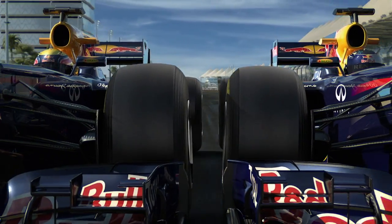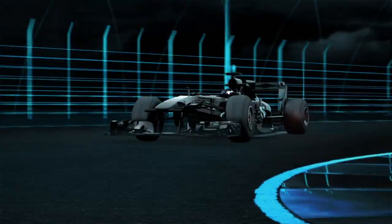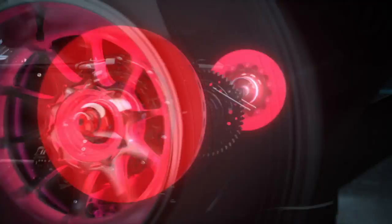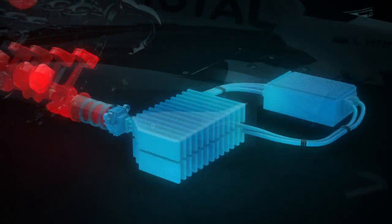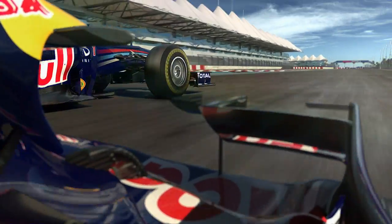Hi, I'm Mark Webber and this time I'm reporting about the adjustable rear wing and KERS. Every time I step on the brakes, the kinetic energy is caught and directed into an electric motor where it's converted into electrical energy and stored in the batteries. At the push of a button, an additional 80 brake horsepower can be sent to the back wheels in either small doses or at once for about 6.6 seconds.